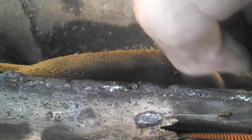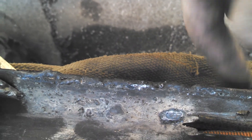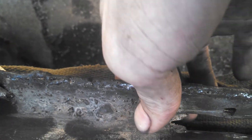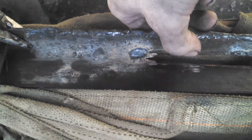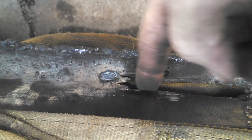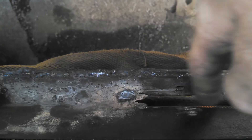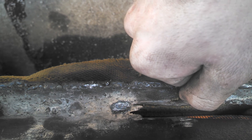It's bed frame angle iron, so it's got the square stamps in it. The only thing I had to do was cut it out and basically make it where it's twice as thick on the bottom. It's got an angle support going to the back corners. I just basically either stick a screwdriver in there or a little bolt with a nut. The reason why this is cut out right here is for the hitch to go through and rotate. It works. Originally I had it right here, but then I moved it back over because it's more centered there.